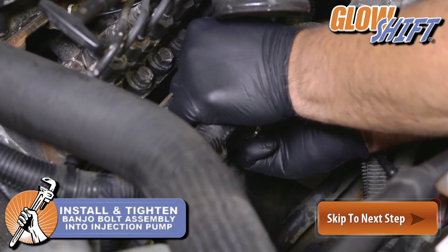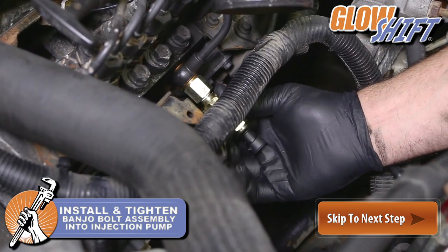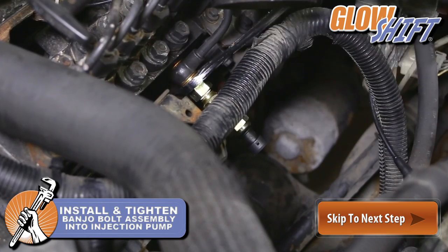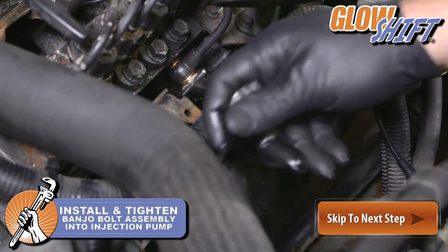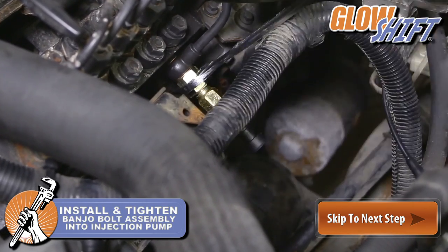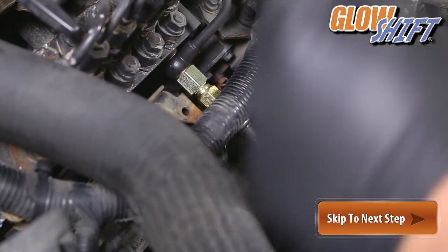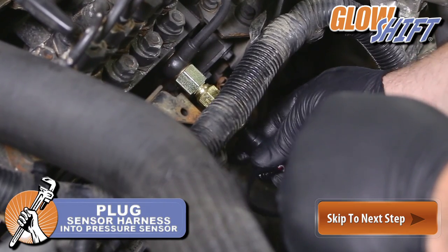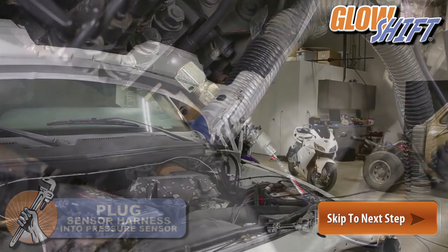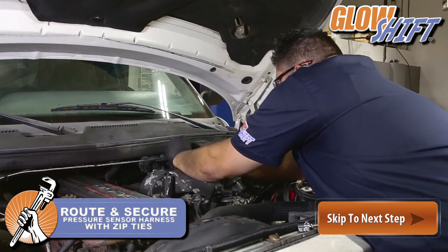Next, take the banjo bolt assembly and install it into the injection pump and tighten. After you tighten the banjo bolt, plug the sensor harness into the pressure sensor. Route and secure the pressure sensor harness with zip ties.